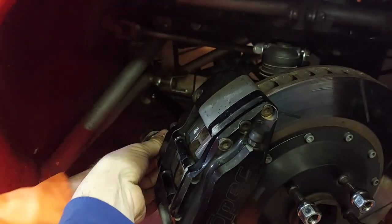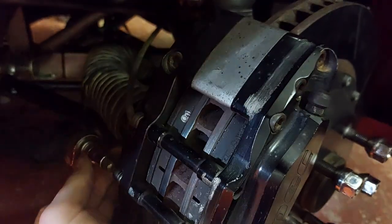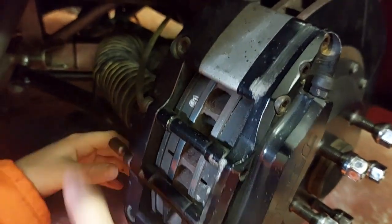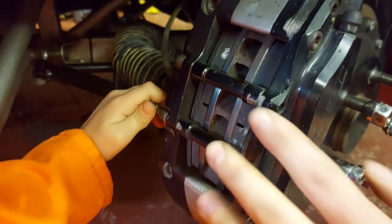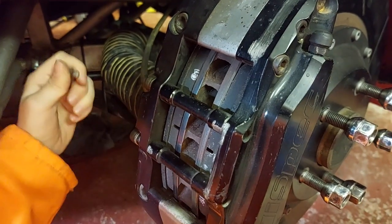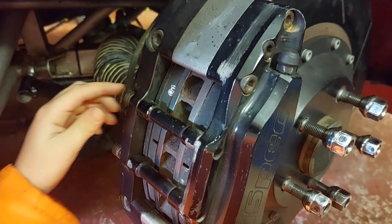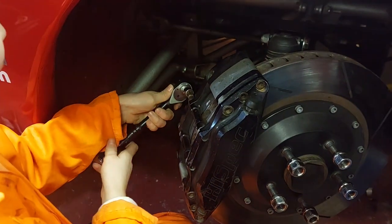The little lady is going to help. So this setup is nice and easy - it's basically two bolts in the back. Pull them out and wind them out with your fingers. Take these two retaining bars out that are held in by the bolts and then you can get the pads out. We'll push the pistons back and then get the new pads in.